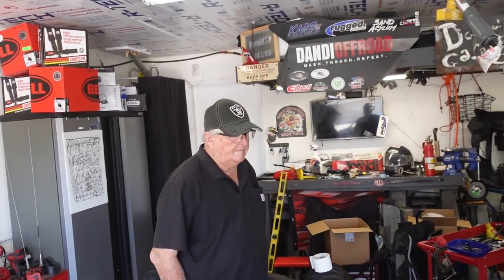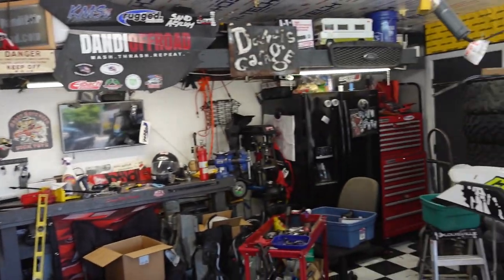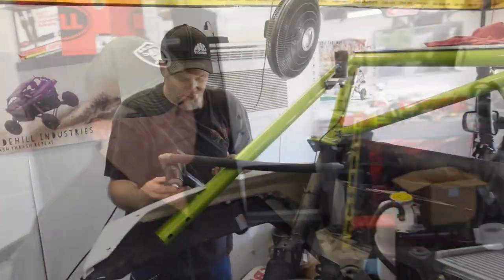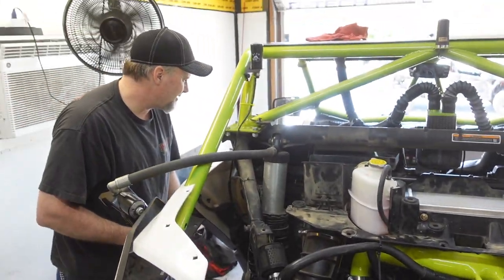So, big concern was that when we fired it up before, we figured out what was going on to some degree, because there was no heat in the radiator, but we had 3-4 bars and the fan was on, so the engine was hot, but it wasn't sending any of the cooling up to the front of the car, because you're running the radiator in the front. So that told us right away, water pump, no do job. That's how we discovered those broken. I remember you in your video talking about that. Now we have heat in the front, so we're pretty confident we have oil pressure, and we're pretty confident that we have coolant. I feel like a run down the road is getting ready to happen.